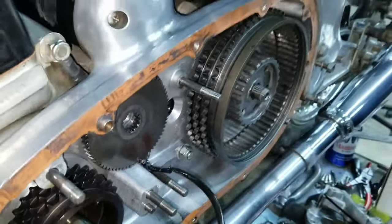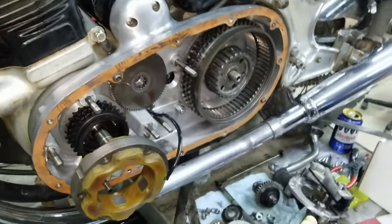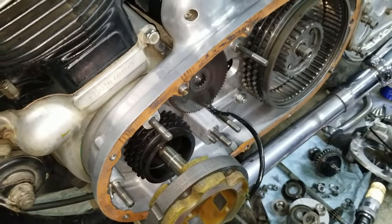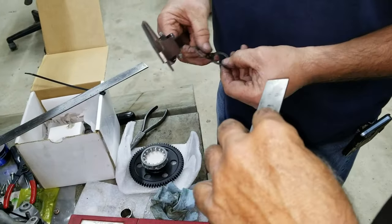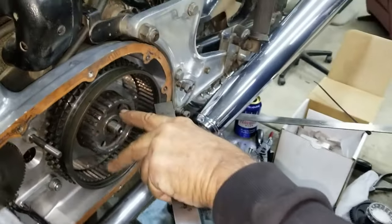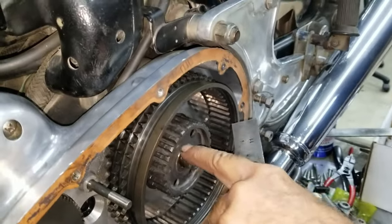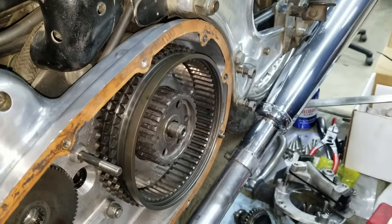You try that, Joe. It's 32 thousandths. These were actually spotted together. Were they? There was a weld in there. It wasn't supposed to be. They might have galled. The unit, you remember they used to have them real soft steel keeper in there? Oh, yeah. And the nuts used to like to come loose. So in time, that might have, you check it.